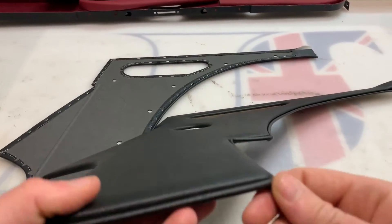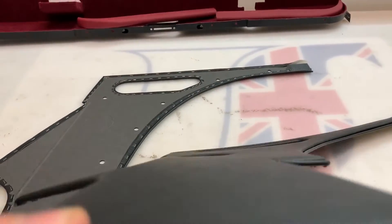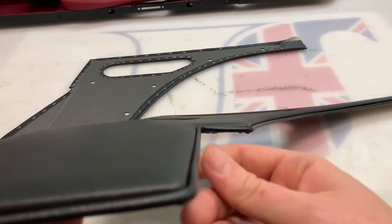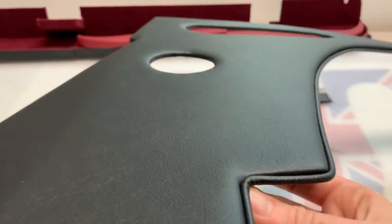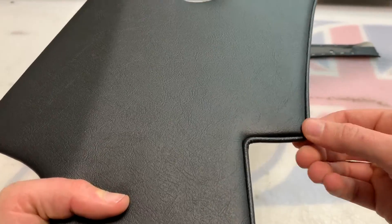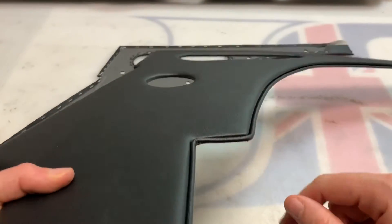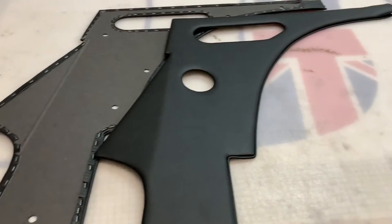It's piped as per original — not all the way around, but on the inside edges here. We use a leather cloth piping where possible. Most colours are available in leather cloth, and the beauty of leather cloth is: one, it's the original material; two, it's a bit thinner than vinyl so it adds a nice neat finish; and three, you can see how nice it is around those corners there. That's because it's not too thick and it's been glued as well. It's very hard to get a finish like that going around corners — most things crease and crinkle up, but ours not so much.